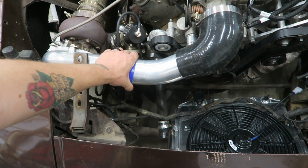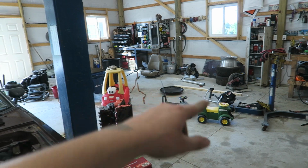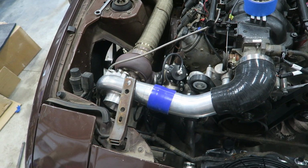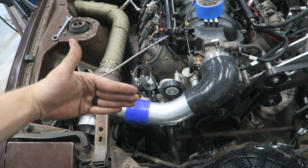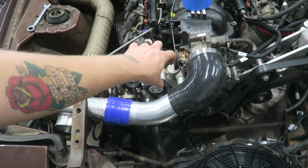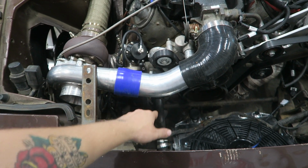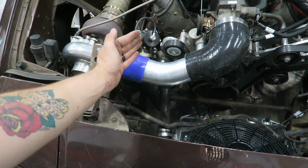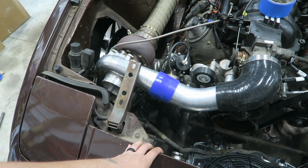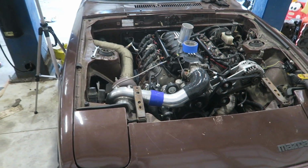You know, honestly, I think it'll work. Just enough room underneath this for the coolant pipe. I think I might just pie cut that and try to make a little piece that fits really good, because there's like 3 different angles. So I think I'm just gonna have to pie cut a piece because it's gotta go down, curve over, curve back, curve up, and then back like this to go straight into that, because I would like this to be rotated up a little bit more, but that's basically what it's going to look like, just with a lot of welds here. Probably 4 pie cuts. I think I'll probably just do 7.5, maybe 10-degree cuts. Not really sure. I'm going to keep messing with that though, but for the most part this is what it's going to look like for the rest of this year, I think.